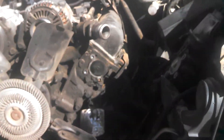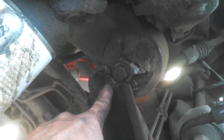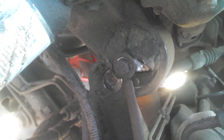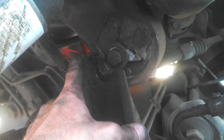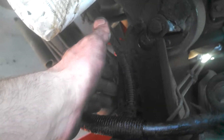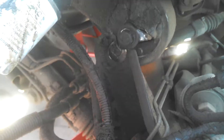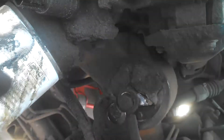It's coming up here. We took the motor mounts loose and they're notched out here so they slide right up. But this piece that's welded on is part of the frame and it may or may not get in the way. I don't know yet, but if it gives us any trouble we'll just go ahead and unhook the motor mount completely from the block.